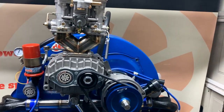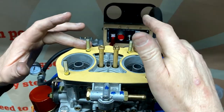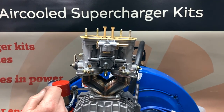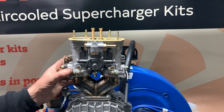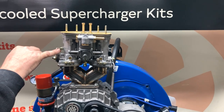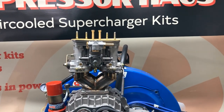Let's get on to the good stuff. We've got the carburetor fitted. We've got a base gasket here for the filter. With this particular carburetor, we've already fitted idle jets which are a size 40. Depending on your engine size we'd also have put in some main jets - this particular carburetor has got 170 mains in it, which seems to do really quite well. We've pulled the air/fuel mixture screws out three full turns, and the idle screw on the side of the carburetor is out just one full turn. Obviously it may need some adjustments, but pretty much most of the time it's about right.